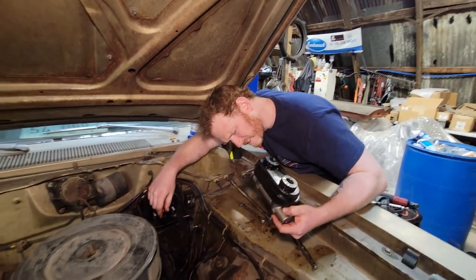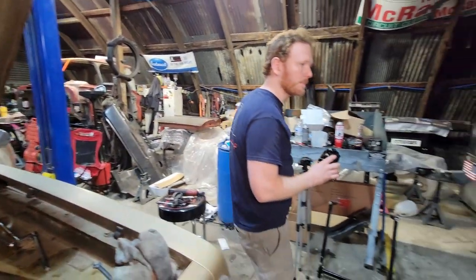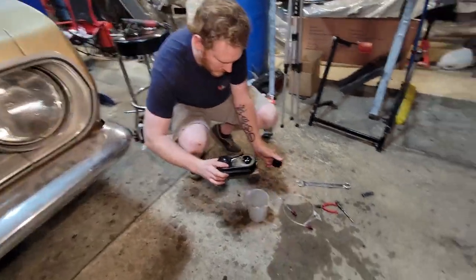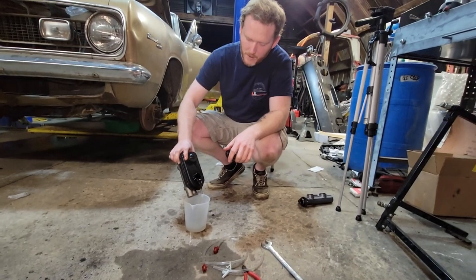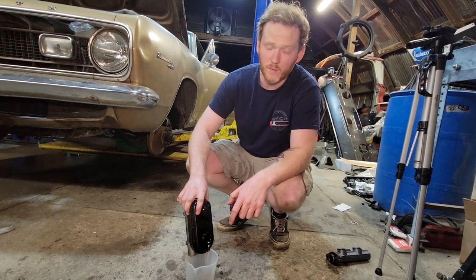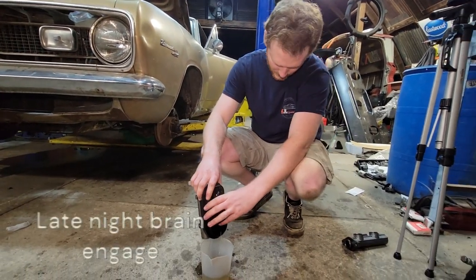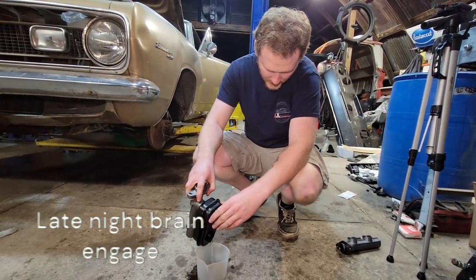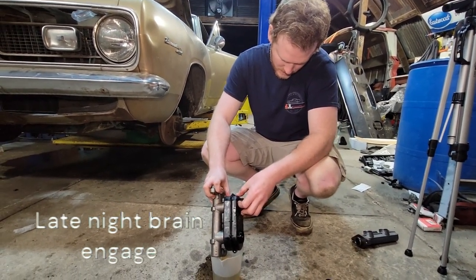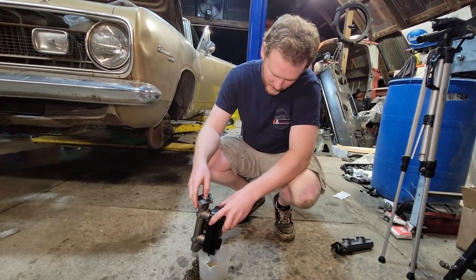What you doing? Well, for the 47th time today, I'm changing a master cylinder. So we're thinking the reason the brakes won't pump up is because the bore diameter of this one is too small. This one's 15/16, and we got a, I think, 1 1/32, maybe? It's bigger. So this one's out of a Dakota, and that one's out of a Dakota, and this one's out of, what was it? An '80 D100? Yeah, the new one is out of an '80 D100. This one's out of a Dakota.